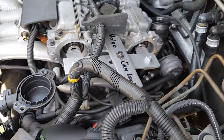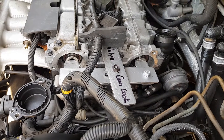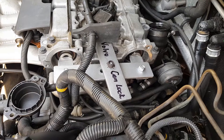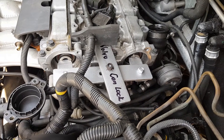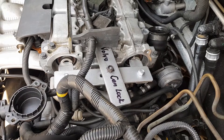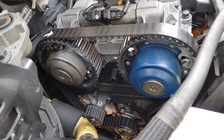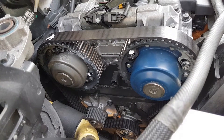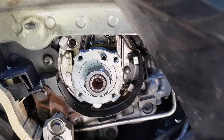One of the things you're going to need is a cam locking tool. I made that tool up the last time I did the head on this. You need to lock the camshafts into position, otherwise you are never going to time this up. The reason you're never going to time this up is because there are no timing marks on the variable valve timing ends.